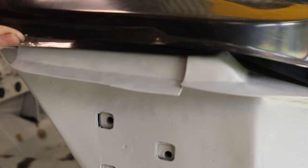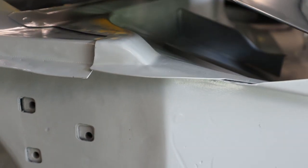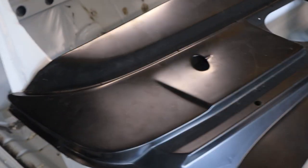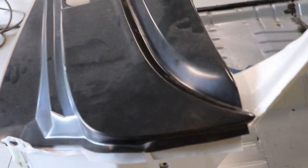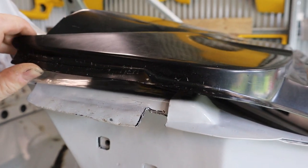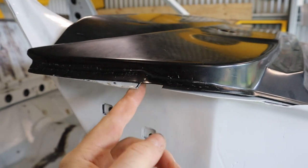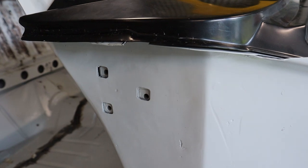With this cowl section, I just need to bend up this piece here just to match this angle — it's pretty close but just needs a bit of a tweak. In one of the previous episodes I had to make up all this new section because it was all rusted. I'll also go around and start marking out where all the spot welds are going to go, and then start drilling all the spot weld holes into the cowl section. My angles were a little bit out so I had to adjust that, and I also had to cut that little section out to allow this to slot in. I had to cut that little bit out and adjust the angle with some multi-grips. It sits in there pretty nicely now.